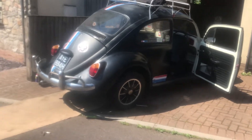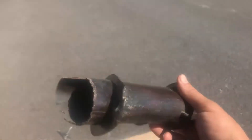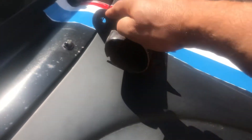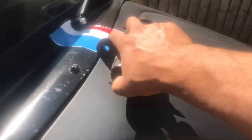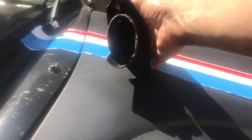Hi, Louie in the UK, 22nd of June 2021. So I'm collecting the heater ducts — this is just a spare — but the way I managed to get them to fit, because really you can't fit these unless the body's off, is I ground down this section here so that it's level with the curve on both sides. It's quite a lot to take off, all of that.